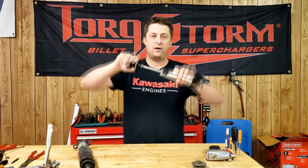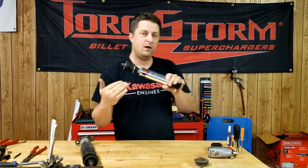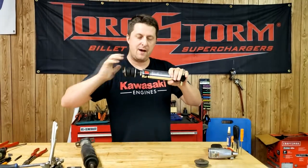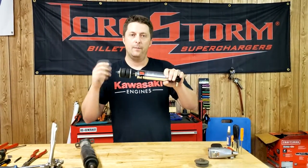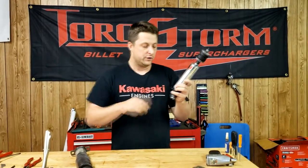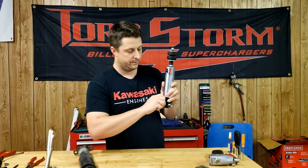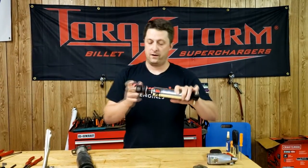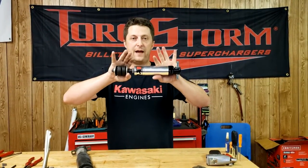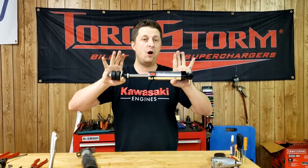On the compression side, I'm going to push it closed as fast as I can. A little bit harder on the compression side, but still has a little give there — and that's all the way loose. So I'm going to go up about three clicks and do the same thing. Now I'm going to pull it open again as fast and as hard as I can. Much harder, but pretty quick and still quicker than the stock one.